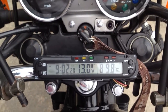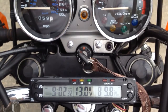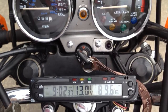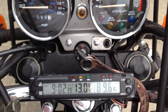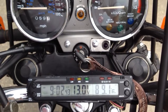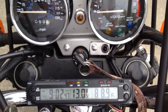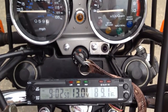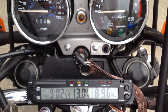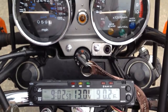Several years ago I added this little voltmeter to my bike so I could monitor the charging voltage. This is wired straight to the battery so there's no appreciable voltage drop in the wiring. What I noticed was when I was riding with the low beam on that I get really what I consider excessive charging voltage, like 15 volts. And with the high beam on it's more like 14.5, and I was afraid I was losing electrolyte or frying the battery on low beam with that high charging voltage.